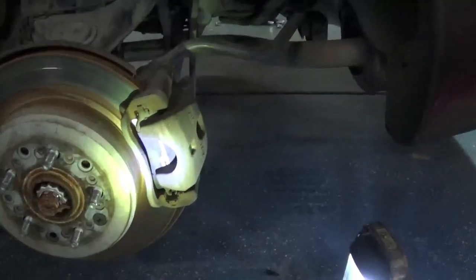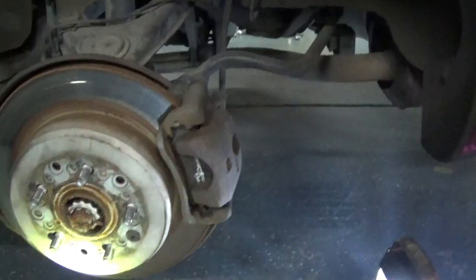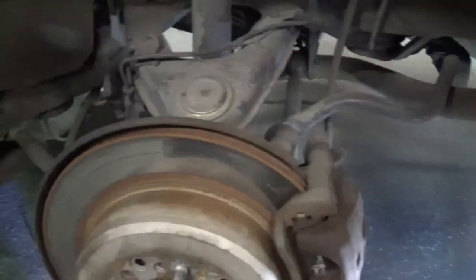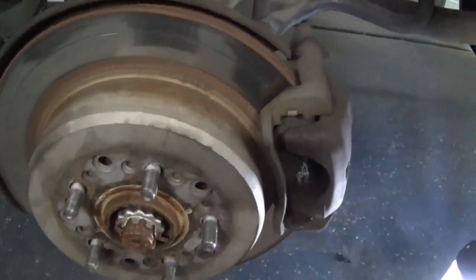It's time for changing the brakes in the back as well as the rotors - it's very dusty in there. Normally if you're just changing the brakes on the Lexus, the rear brakes are a little different than the front. For the rear brakes the easiest way to do it is to undo this bolt and loosen this bottom bolt here, and this part just swings down and you can replace the brake pads right there. But because we're replacing the rotor too, I'm going to have to remove the whole rear caliper to get the rotor out.